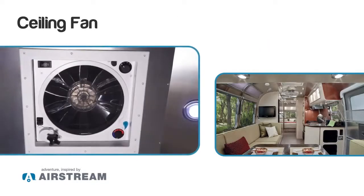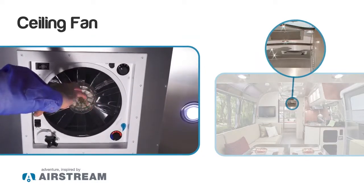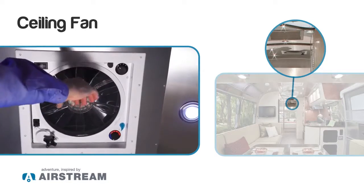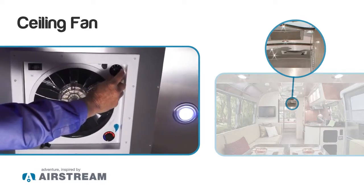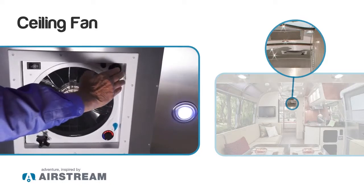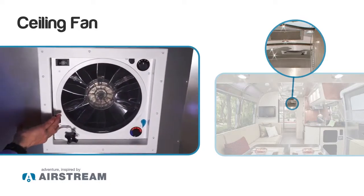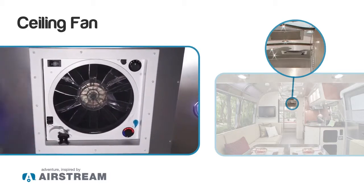Okay, next we want to sort of go over the Fantastic fan. This fan has a rain sensor, so if it's raining on the outside and the little sensor gets wet, it'll automatically close. But to start using this, we'll go over here with this fan speed. Right now it's set on 0, so we want to turn that at least to number 1. Then we want to come over here and press the button that raises the fan. The fan will automatically go up.